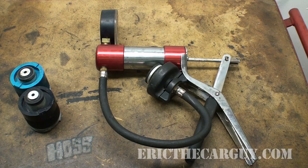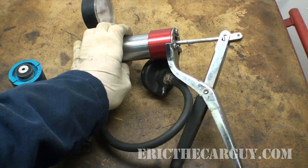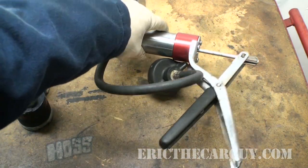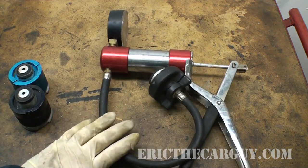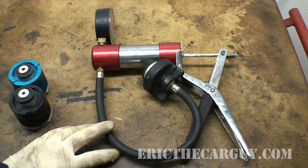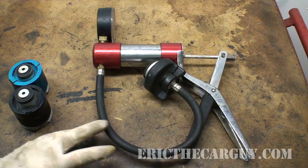Also, stuff is going to leak out, and if stuff leaks out, that's when air gets introduced into the cooling system. So today we are going over the process of pressure testing the cooling system and looking for those leaks to try to determine where they're coming from so we can complete our repairs. Let's get started on this Civic and figure out why it was spraying coolant everywhere. Let's start with the tools. This is a pressure tester — they come in different configurations. Mine was made by Mac; I'll post the link in the description. They're not that expensive, but you may also be able to rent or borrow one from your local auto parts store.